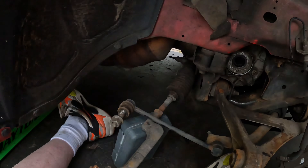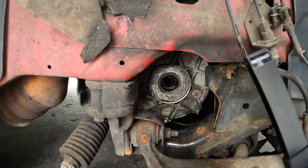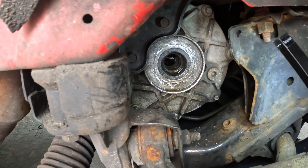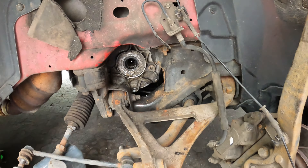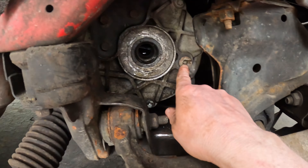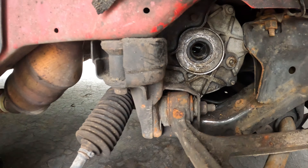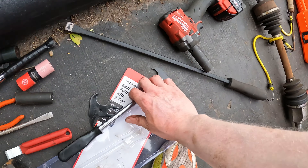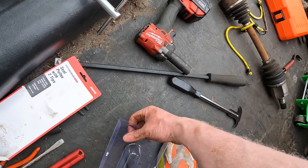I'm going to clean all this up. You guys see right there all the liquid — this seal right here, that's what's leaking all the fluid everywhere. We're going to clean this all up, then refill it. Luckily the diff drain and fill plug is right here. Put the new axle back in — well, not a new axle, put this axle back in; you can see it's still brand new. This is the seal puller from Harbor Freight — I'm going to use this to take out the seal and clean everything up.